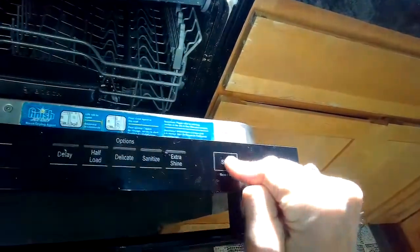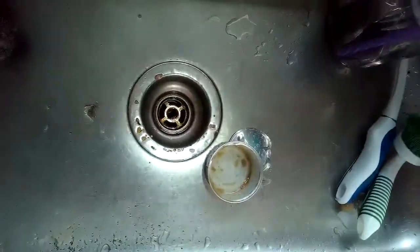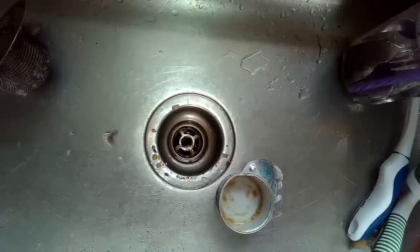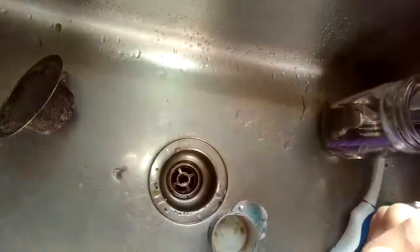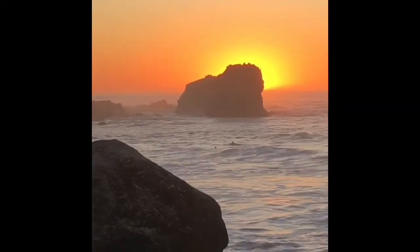It's filling with water and circulating as it should. Now let's see if it'll drain — I hold the start button for three to four seconds until it says zero zero one, then close it and it starts to drain. We can hear it and see it working. That's all it needed — just getting that piece of glass out that was stuck. Almost never do you need any parts; it's usually just freeing up whatever was jamming the impeller. Thanks so much for watching — please subscribe and we'll send you more repair videos.